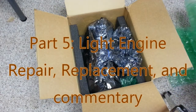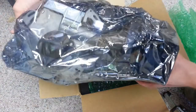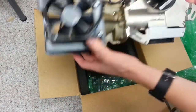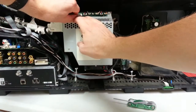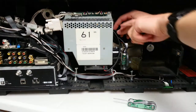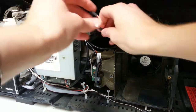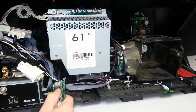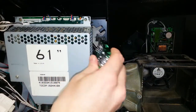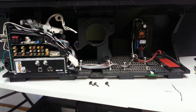I realize there isn't much point to replacing the light engines in these things anymore, but there are some serviceable parts on them, so it's useful to know how to get the thing out, and it's thankfully not that complicated. It's possible to get to most of the stuff on the light engine with it still attached to the television, but removing it is a simple affair of just loosening the screws holding it to the set and disconnecting the cabling — keep in mind those screws are the only thing holding the whole engine in, as it's completely suspended off the floor of the set. If you just want to adjust an off-kilter image, display a good test pattern and then loosen the screws slightly before carefully adjusting the tilt. For those with a bad light tunnel, or a noisy or broken color wheel, those parts are fairly straightforward to replace.